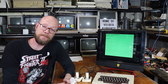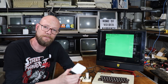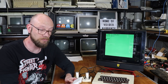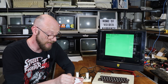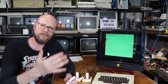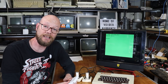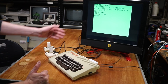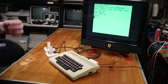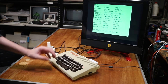Before we actually dig into the computer, I'm not going to be using either a disk drive or a cassette deck to load software on the Laser. I'm actually going to use this. This is an SD card designed and built by Ben from Bennvenn Electronics, which simply takes a micro SD card. And you can, from the ready prompt, load VZ images. VZ files is basically the standard for disk images, and this will load them directly. It also provides a 128 kilobyte memory upgrade, which is always a bonus. So here is our Laser 310 all plugged in — we have our ready prompt, and all the stuff for Ben's SD card has loaded.